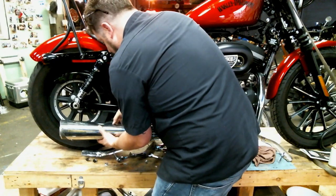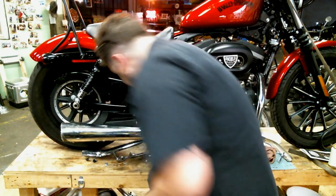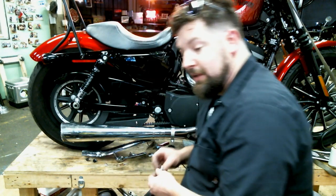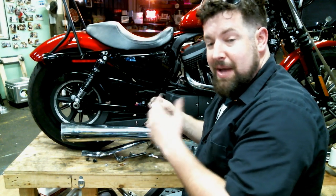Yeah, for sure. Line up the bolt. That could be all it is. Pretty self-explanatory. Make sure it's all square. Now, as I'm putting all this together, I'm not tightening any one thing down. I'm just loosely putting everything on there. That way I can get everything lined up and in place, and then I'll go back and torque it down